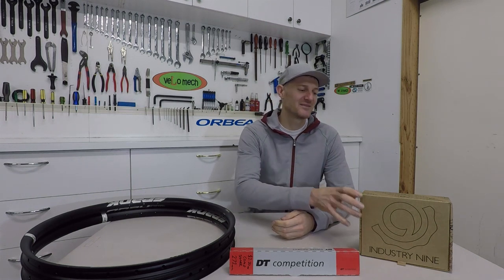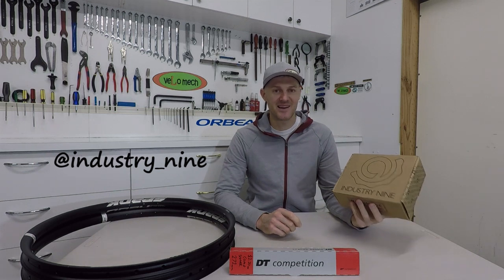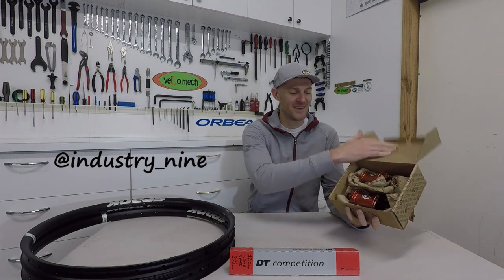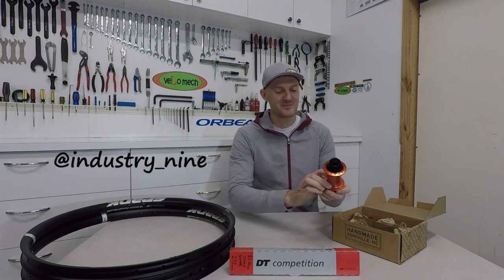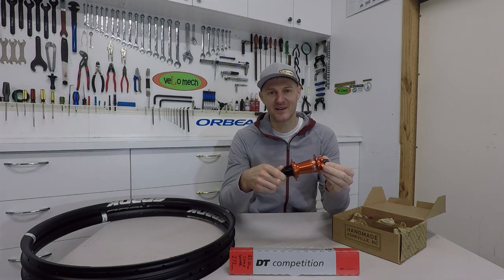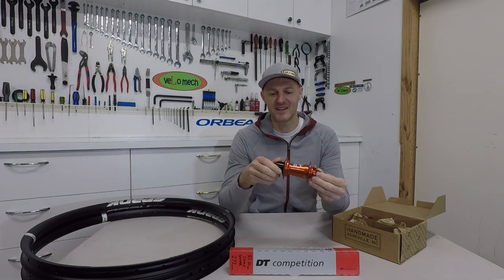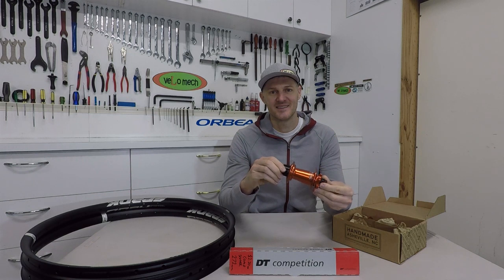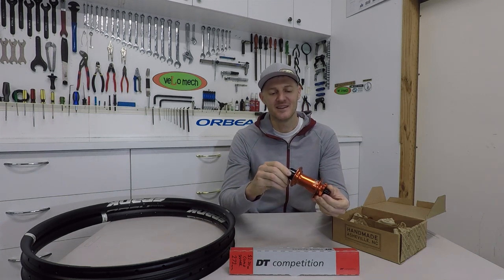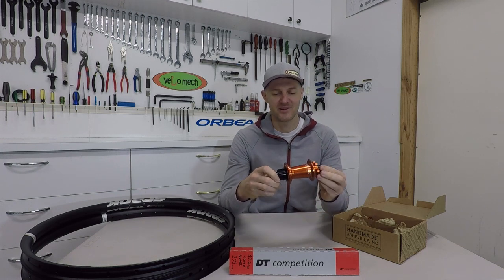Changing to the Industry Nine is a bit of a gamble, I guess. They're a little bit cheaper and a little bit lighter than Chris King. But the thing I wanted to try was the fact that they have absolutely hundreds of engagement points. This is the new Hydra hub — it has 690 engagement points. Chris King has 72 engagements, and an old classic Shimano hub has 16 engagement points. So there's very little deflection when you crank back to load the power — everything's just all go. Hopefully that'll translate into smoother, easier riding on the trials bike.